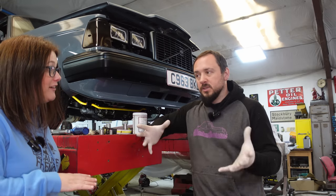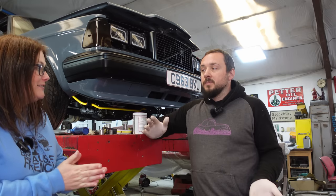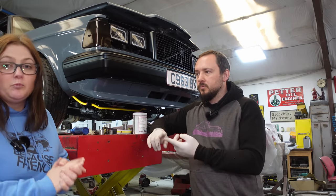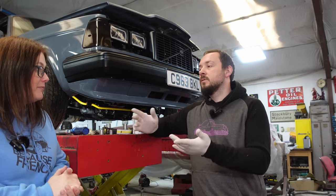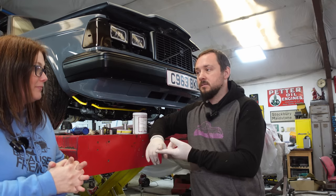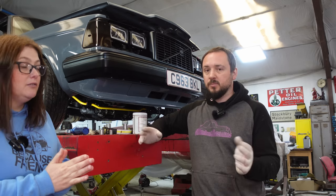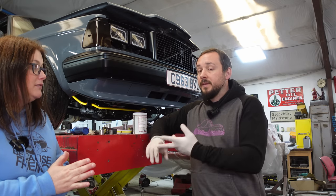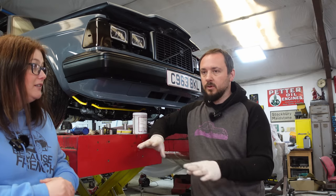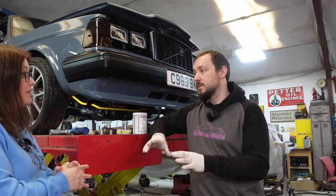They were disgusting. I should have done them with the rest of the undercarriage — I didn't know whether an upgrade was going to be coming or not. At the moment we just can't afford it, so we've refurbed the standard ones. We used paint stripper to get off all the muck and goo and paint. It strips them really fast — you don't have to bother cleaning them or anything. You just put paint stripper on and it rips everything off. And then electrolysis, which is the best way of removing rust. All the rust just came off so nicely.